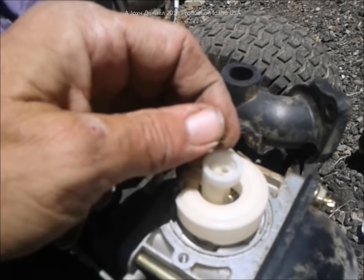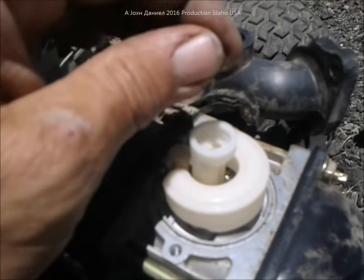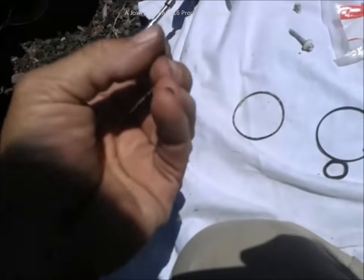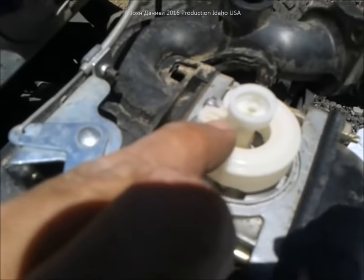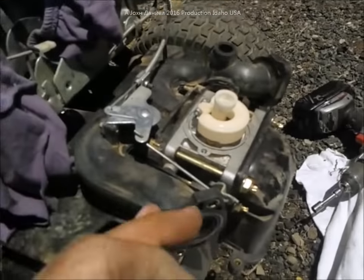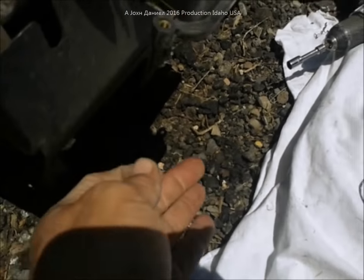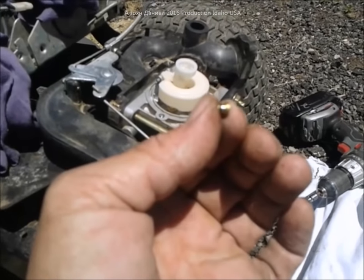Very carefully, you're going to take a needle or a very sharp little probe tool and carefully lift one at a time out. Do not remove both because you're going to put one back at a time. These jets are literally a 30th of a millimeter difference — very hard to tell with the eye, though you can probably see numbers on them with a microscope. You can see that O-ring is quite flat. We're going to replace that, then pull the other one out after installing this one back. Put a large rag or t-shirt down underneath so your parts don't get lost — each one of these jets is about $15 if you lose it.